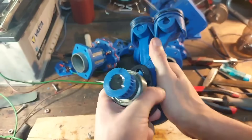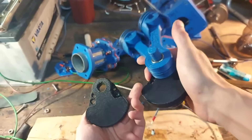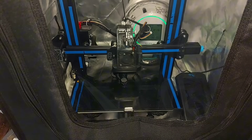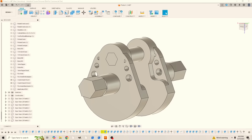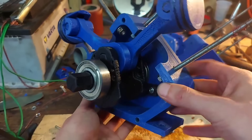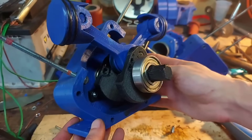But while I had the engine disassembled, I noticed the crankshaft had gone loose again. So I had to redesign and reprint a better crankshaft — this time I designed all the mating parts with a hex shape so we are not going to have any slipping issues. After installing everything, it's time to give it another go.